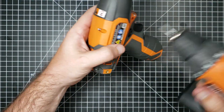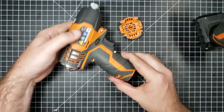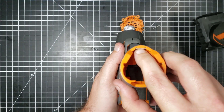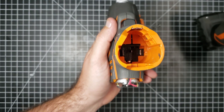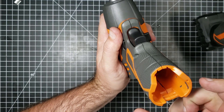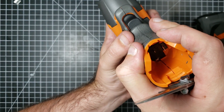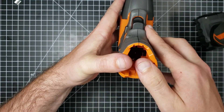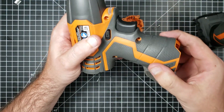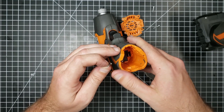Let's take it apart because these housings are going to be a lot easier to see separated. Right off the bat there's some pretty unique assembly processes going on. See this sheet metal piece right here? All that's doing is keeping the two halves of this housing pinched together. It's not really meant for strength — you can see how the plastic just kind of bows out. Plastics always warp a little bit, so unless you put screws every quarter of an inch, you're going to have a little bit of warp. This is a really inexpensive way to improve the form and fit of these two housing parts.